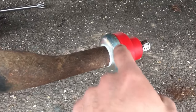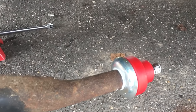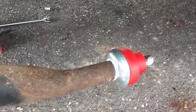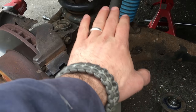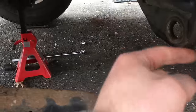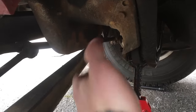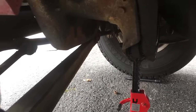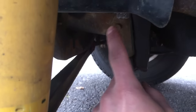I have my washer and bushing on there — that white stuff is white lithium grease. I put it on there so that the bushing itself is not riding up against bare rusted metal; I feel like it's just going to add a little extra longevity. When I've done Prothane in the past they usually give you some grease so when this moves it doesn't make any noise. The next step is to jack up your front suspension and elevate it enough so you can stab it back in there. Once that is stabbed in, go under there and push your axle pivot bushing back up into place where it bolts up. Put the bolts in there and we'll move on.